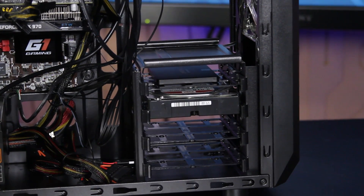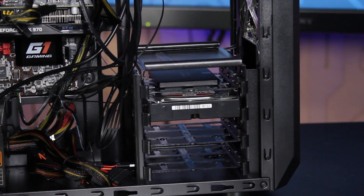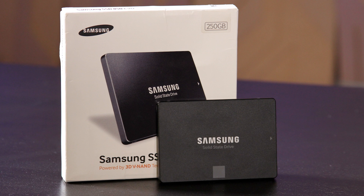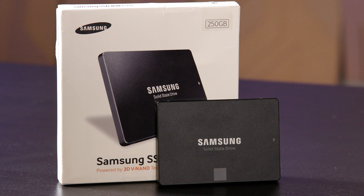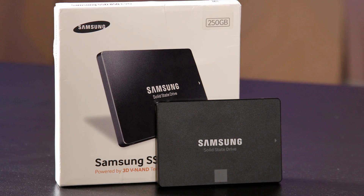It's a non-linear change in cost. One of the other things we were talking about is that you have two forms of storage here — an SSD and also a two-terabyte standard hard drive. If you build a PC that doesn't have an SSD at this point in time, you're shortchanging yourself immediately. The performance benefits of an SSD in boot-up time, application start time, game load time, and level load time are immediate and dramatic. But the cost per gigabyte is way higher on an SSD than on a traditional spinning disk. So we went with the 250-gig Samsung 850 Evo, which is a fairly high-performance but budget-friendly SSD. You can get some cheaper and slower ones. That's an $88 part.